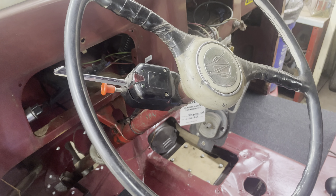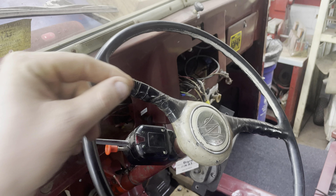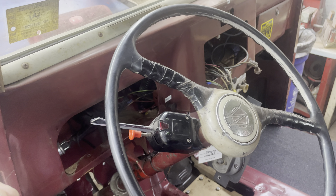My phone and radio are up top. In the gauge area I'll have my Bosch RPM gauge for running the overdrive and rear PTO - so you know exactly what RPM you want to be at. Then I'll have a dual voltage setup showing my main starter battery and my auxiliary yellow top battery for winches and lights. And then a classic fuel gauge. So all my primaries will be there besides the speedometer.